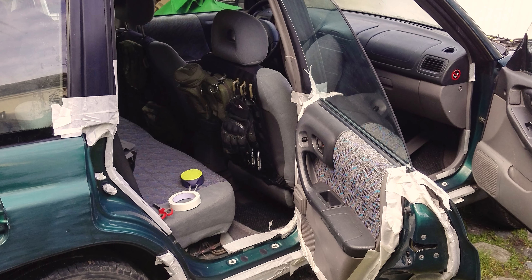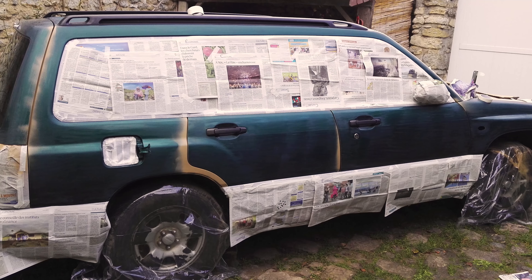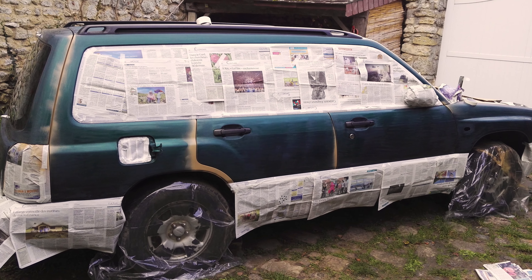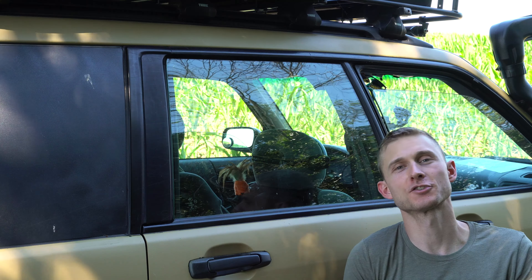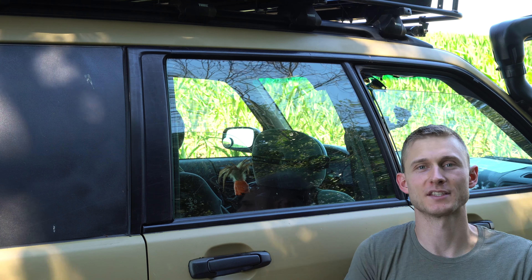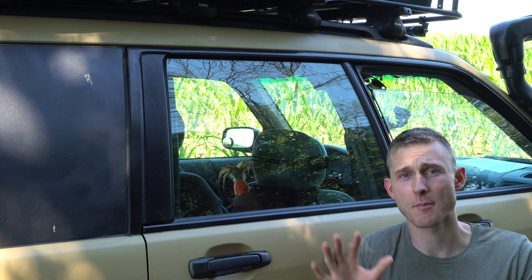You have to think about everything — plastic trims, seals, interior, the wheels, everything. And the Montana 94 having a very high covering power, you also want to cover the floor and everything else around your painting area if you care about it. Before starting to paint, you want to make sure you clean and degrease the whole surface. For that I used white vinegar — it stinks but it's less likely to mess up with your paint.